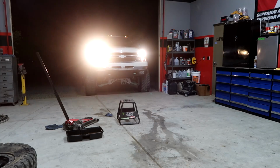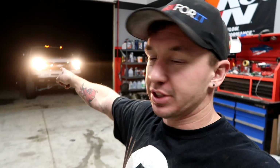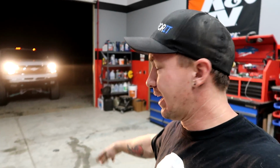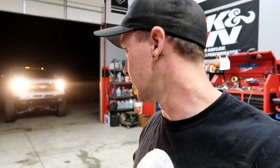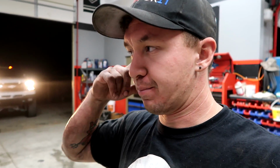Alrighty guys, that's pretty much gonna do it for today's video. We got it back running, no leaks, no nothing. Everything's good. The radiator is no longer leaking. I rinsed it off real quick, checked the front end. It looks like outer or inner tie rods and maybe a pitman and idler arm. Some stuff I'll check tomorrow when the light is better. Wheel bearings are good and all that good stuff, but we're gonna go home. Tomorrow I'll probably test the injectors and everything on it, but pretty much just giving them a full run through to make sure everything's solid on it.